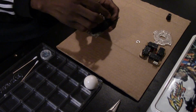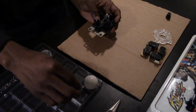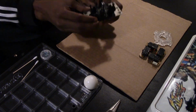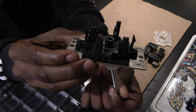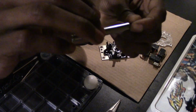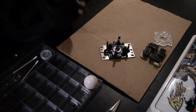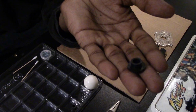You lose an actuator that way, and then you're spending more time playing where's my part versus actually cleaning the joystick lever. So that's the actuator. That is by Kowal, the 1mm oversized actuator. Now, as you see, just pull the shaft from the body, and that's the pivot. We're gonna clean that up real good later. And just put that to the side. This is your standard JLF shaft. This is the spring base.